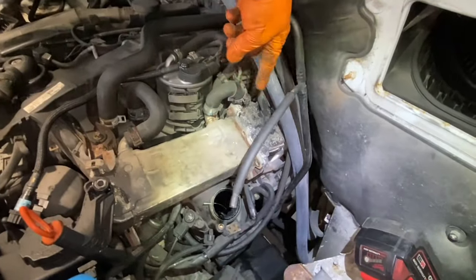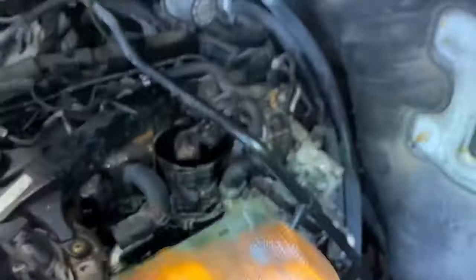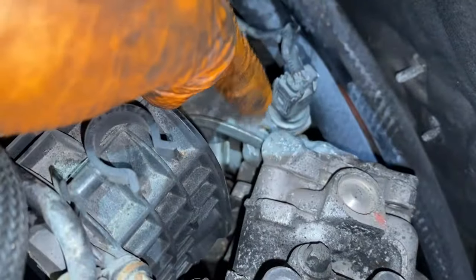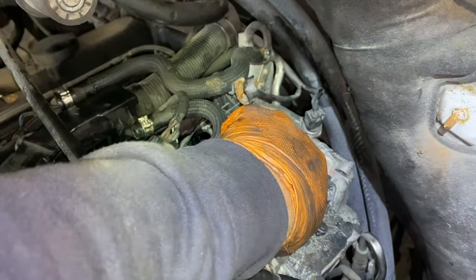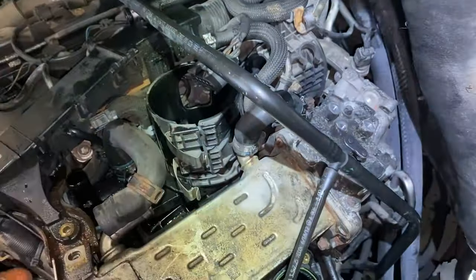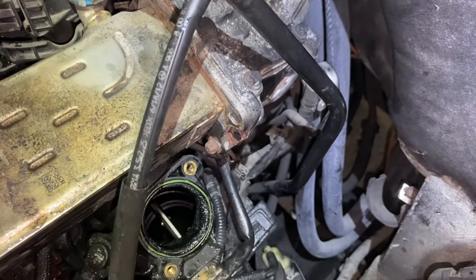I'm going to head back in the rear and see what's holding the EGR cooler on. I'll start pulling out a couple of bolts. I've taken off the EGR cooler actuator - E6 Torx bolts holding that in, three little bolts. I can see someone has had a bolt out before me in here. There are two pipes across where it gets its exhaust gas from. Once I get that bracket out of the way and disconnect the block connector, I should start getting some room and maneuverability.